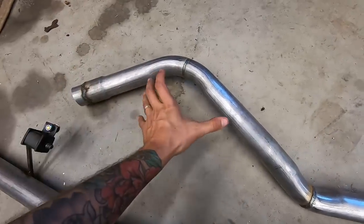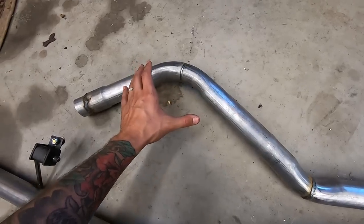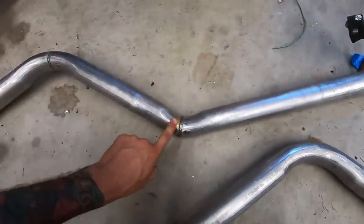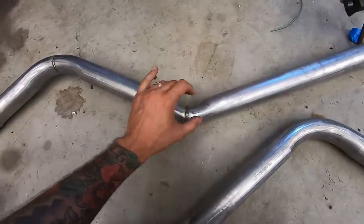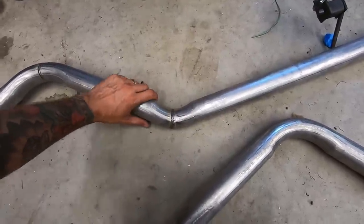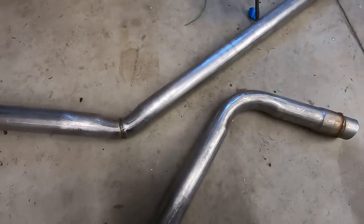I had to open this one up and close this one. So cut on the top here, opened it up. If it wasn't enough, I took a blade's width again, opened it up, blade's width, opened it up, blade's width, until I got where I wanted to. Same with this side. Cut a blade's width in, bend it in, wasn't high enough. Cut it again. Just get it so they're touching, and then cut straight through with the bandsaw. I'll kind of show you on this one, because I didn't do this side yet.